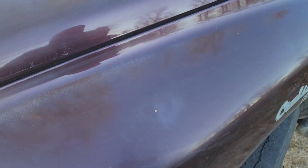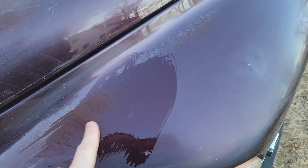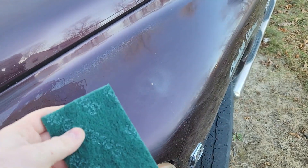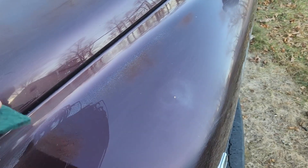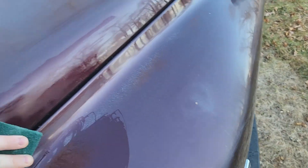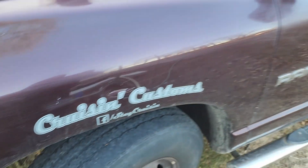I've already started over here. You're going to want to wet sand this. You don't want to do this dry — you want to do this wet. The reason is when you do it wet, it doesn't pack the Brillo with any gunk that you're scrubbing off, and it doesn't cut and bite just quite the same. So it's just a nice scrub — we're going to keep going until everything's dull. You can see on this side where everything is clean and yet dulled out. You can see the little micro scratches in there, and that's what our clear needs to bite into. Down here still has a gloss; this up here is matte.